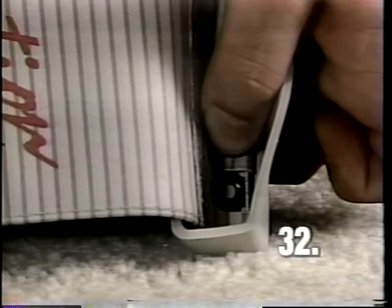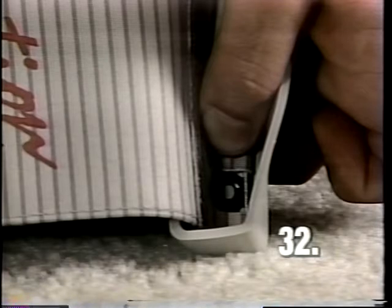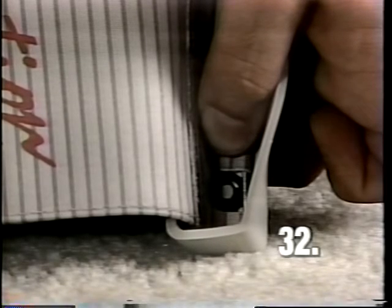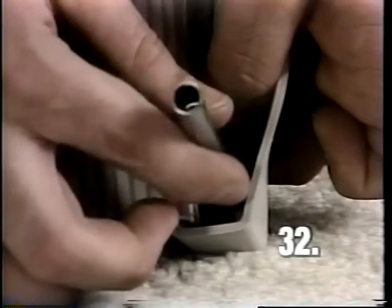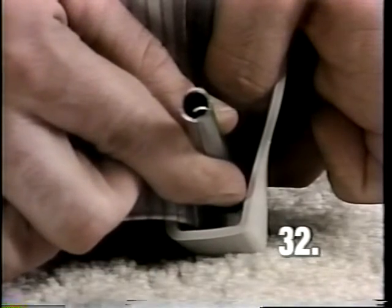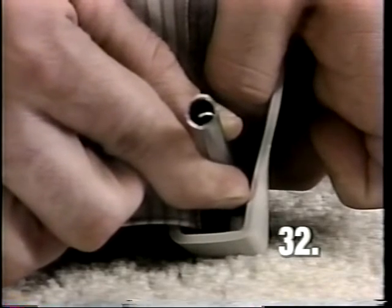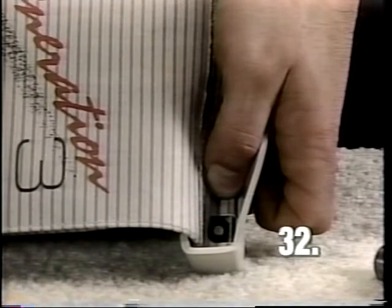Install the hanger bar onto the tabs of the bag top by placing one end of a handle fork spring shaft, part number 137173, over the washer and tapping down until the washer is secure to the tab on the bag top cover. The bag top cover then should be securely attached to the bag assembly.